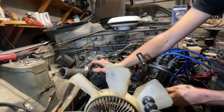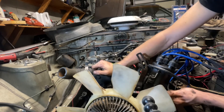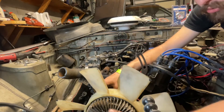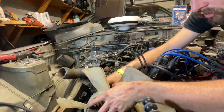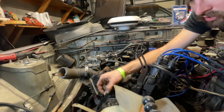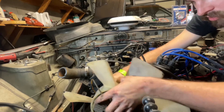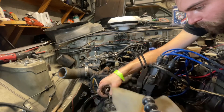So a little trick — ideally what I should have done was loosen all the bolts while the alternator was still on, but we didn't do that. So if you forget, you can pull the belt with one hand and loosen the bolts with the other, and it keeps tension on the pulley and thus allows you to loosen the bolts. These aren't crazy tight, they're not supposed to be — and you don't want them too tight cause they'll break, they're so small. I think they're like little M8s or M10s. I know standard thread bolts, I don't remember metric thread anymore.